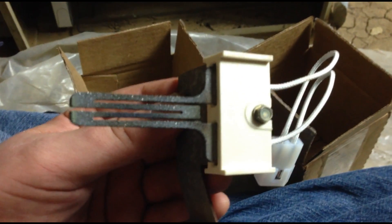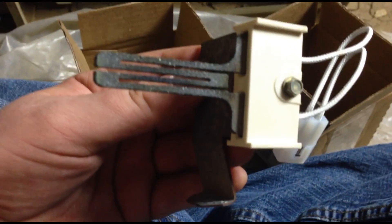Alright guys, I went back and now I'm on my second igniter. I cannot express to you how fragile these are. When you go to put it back in, I'm going to be putting it right there on that hole — that part right there is going to slide in there and this part is going to sit behind it all. I'm putting the camera down because I do not want to break it again. I'm already at about $70; to call a repairman it would probably cost more than that. Okay, so you can see here now — that was the nut I just put in there — and you can see the igniter, the ceramic part, is just sitting there. I'll go ahead and plug that back in.